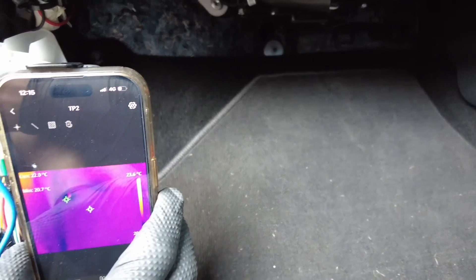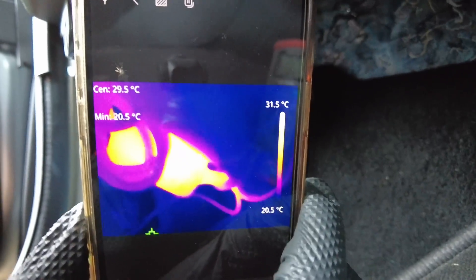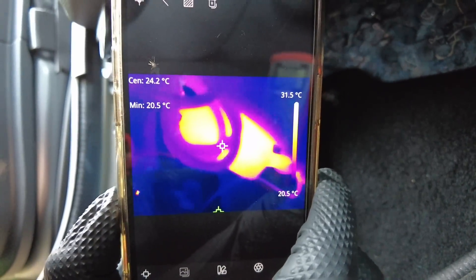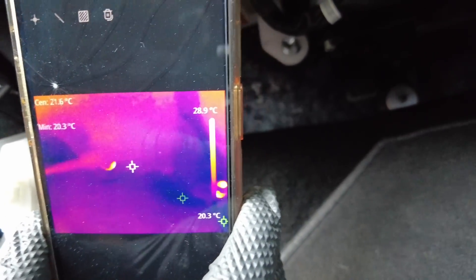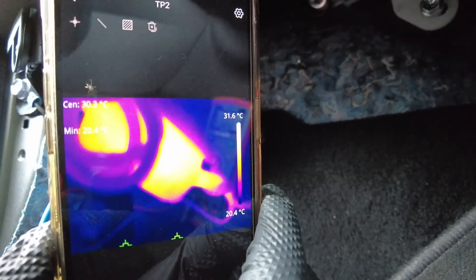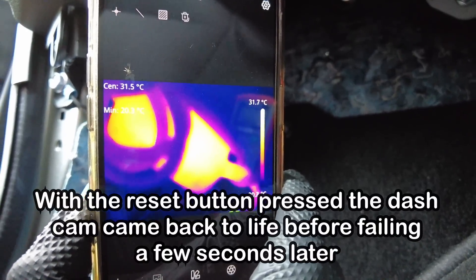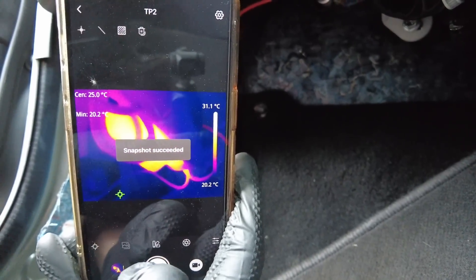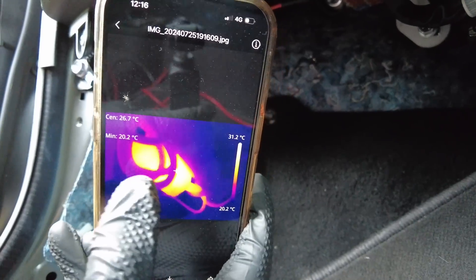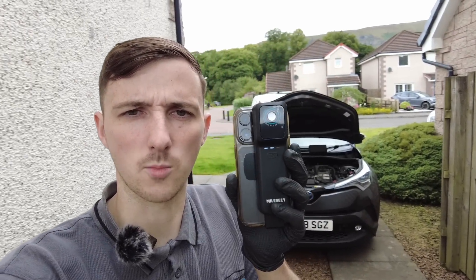Let's try the thermal imager on it and see if it can pick up any excess heat. We have got our thermal imager connected up and you can see that heat signature there — that is the camera module, the little camera box that gets wired into that fuse. We've got a massive heat reading there, which is obviously the cause of our drain. We can also take a picture — click the picture button and that takes us to a photo album. That's a picture for the customer in case they ask for proof. That little thermal imager picked up that heat spot no problem.